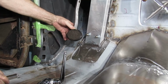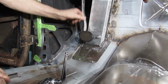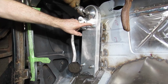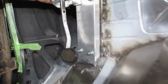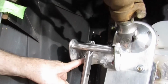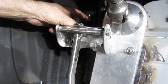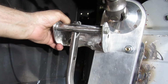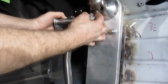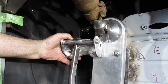We can knock the head off or the tip off of that bolt. Yep, well, we'll take them off, all of them. But except for this one. This one here, we're going to put a bracket over to here. We'll weld on the side of this. But I want to make sure everything is squared. And then over here, we're going to put a bracket. We got another hole here. So we're going to go way back into the bracket that holds the booster onto the firewall. And that'll tie all that in together and be strong as old cheese or close facsimile thereof. We got plenty of clearance here for our steering. Got everything rounded so we're not ugly looking.